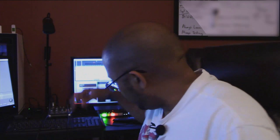What I decided to do is, because we do a lot of streaming, we stream high school football games, sports games, other professional teams locally here, as well as churches, events, concerts, and things like that, along with the studio, the ATEM video switcher that we got, building out the equipment to be able to properly live stream. But we don't want to carry a whole PC. I think I've done a video before about my streaming PC, which, you can't see it, but it's on the floor right now. I actually built another one for a church where they do some streaming, and they work rock solid with the Ryzen 3 2200G, because it has a built-in GPU. It handles 1080p at 60 frames a second without even topping out at 25%, so I mean, it's rock solid.